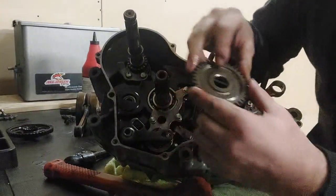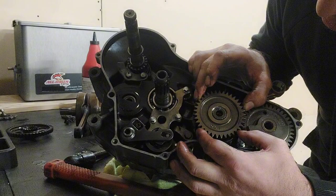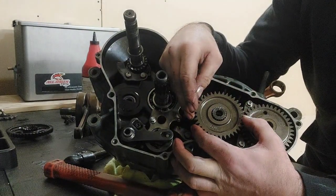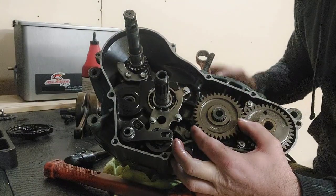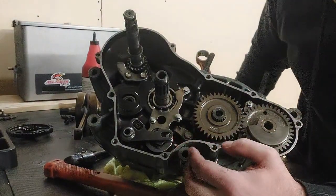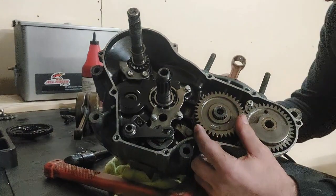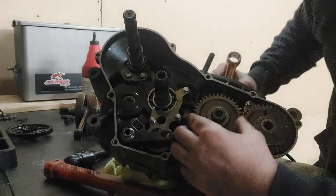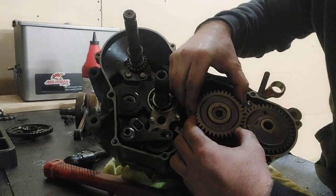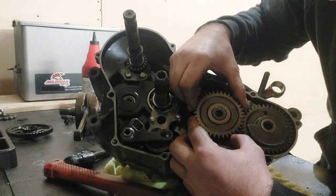So this is the crankshaft gear, and it also has a dimple on it, which lines up fairly close with where that scratch mark is. And that's pretty much the center pin. Not a huge fan of that, guys. I'm really bummed there's not a pronounced mark on there. But I think if we go one tooth in either direction, it's going to be really far off.